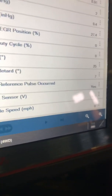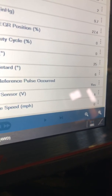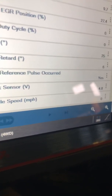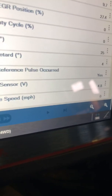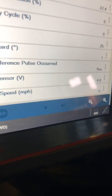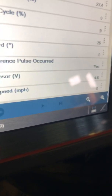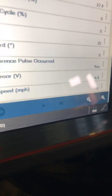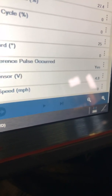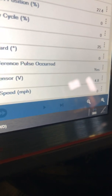Watch the CMP retard — we're going to want to get that to zero. I'm actually turning mine clockwise right now in small increments. Down to four, down to three, down to one — zero. Let me go a little bit more. Zero. At which point you're going to want to go ahead and tighten that bolt and confirm it's at zero.